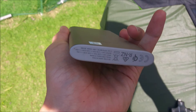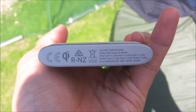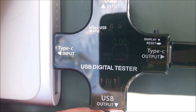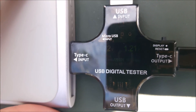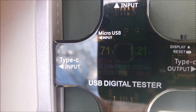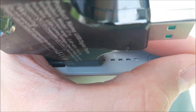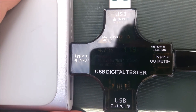Now we're going to test the Samsung 10,000 milliampere power bank individually. We're going to use a USB multimeter to test the voltage and amperes going in. Currently it's inputting 4.87 volts with 0.48 amperes, and now it's 1.21 amperes with 4.71 volts — the load is going into the power bank. The indicator light is just one because this power bank is completely depleted.